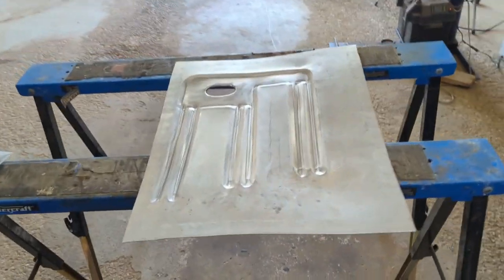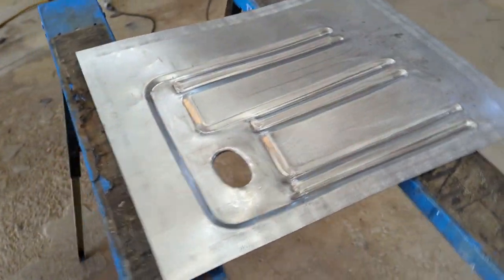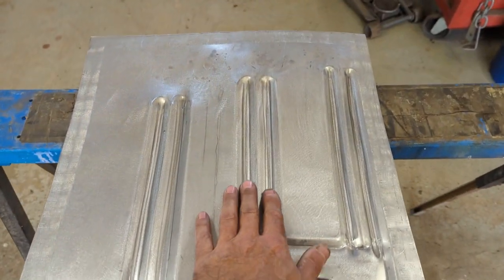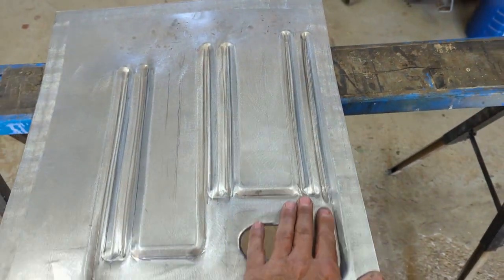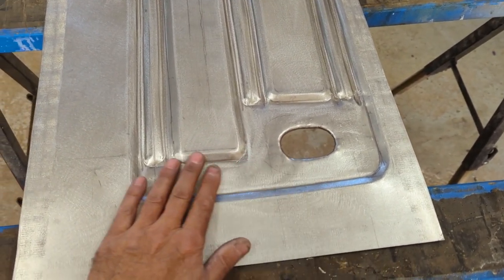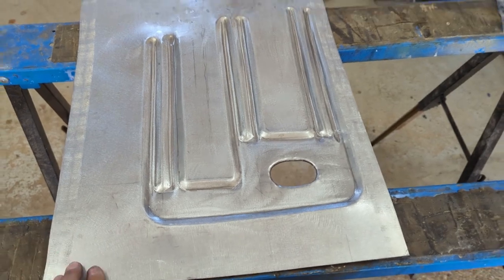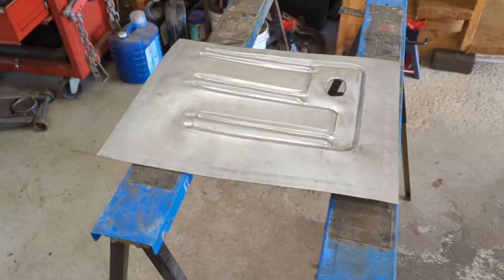There she is — the hole's cut. Panel's a little bit warped but I'll be welding it into the car anyway. I went back through with the 3/8 dies just to straighten it out some — I didn't like the look of what I had earlier. I cut the hole out, used the vice grips to straighten it up and ground it off a little bit. Did a little shrinking and stretching here and there around the perimeter. It's warped, but I'm sure it'll work fine in the old Thunderbird.